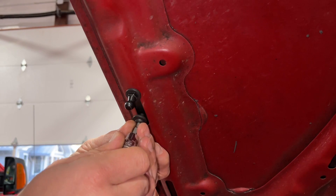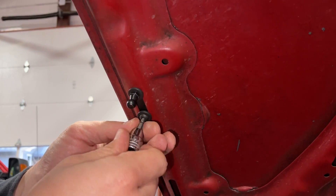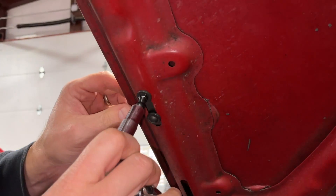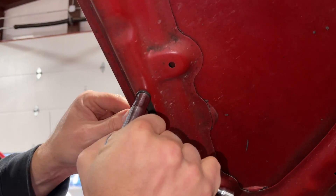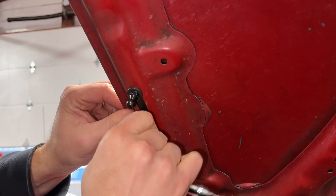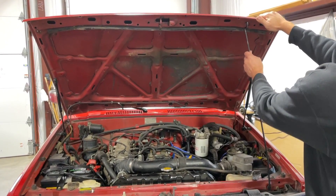Find the lower hole in the nut plate and keep both finger tight so you can raise it all the way up. Use a 10mm socket to snug the ball stud down and a 4mm hex to tighten the lower one down.